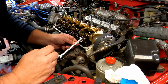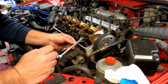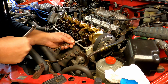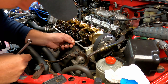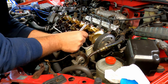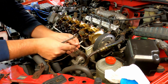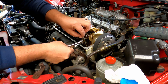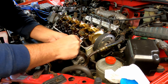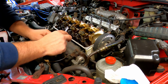This one's good, but you just want to get a slight drag going in — that's how I've always done mine. I'll adjust it out so you can see what's going on. See, now when I put it in, it's too loose, it's not dragging at all. So then you just turn it by hand to get a little bit of drag on it, then snug it up with your wrench and check to make sure it's good. Then I'll come back and follow up with a torque wrench.